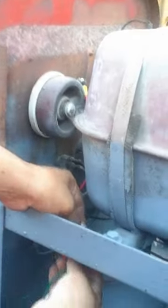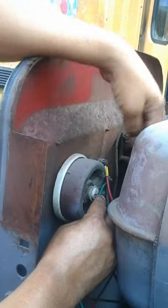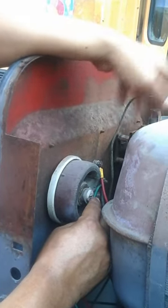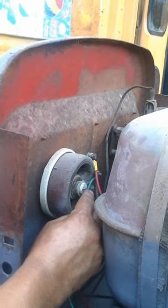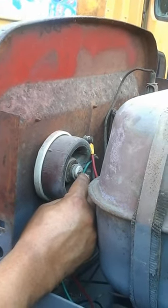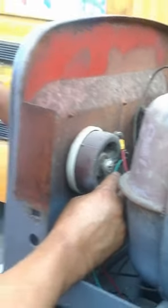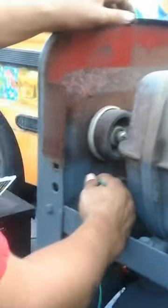What I'm going to do is take this wire and just plug it into the middle of the rheostat, because I do not want a toggle switch. So now the only thing I have to do is when I'm working, I put the rheostat on zero and plug in my remote. When I unplug it, I just control the heat through the rheostat. That's about as easy as it's going to get to install a remote on a Lincoln SA200. Thanks.